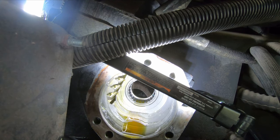And then I'll follow that up with some brake clean, which will just drain out. And brake clean, if you don't know it, it flashes off and it's supposed to leave no residue. And it will break down the oil, but all of that oil that breaks down is draining out. So no worries there. The idea is to flush out anything that might get in that bearing. And the seal chunks probably won't hurt that bearing because they're so soft. The bearing will just smoosh them into a paste.